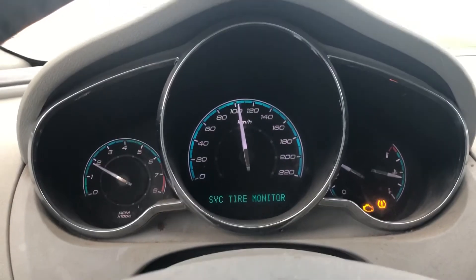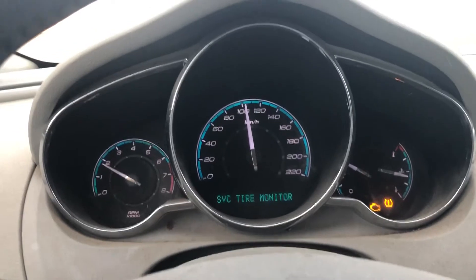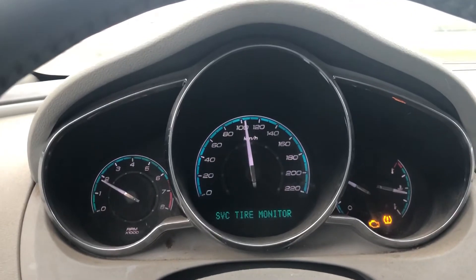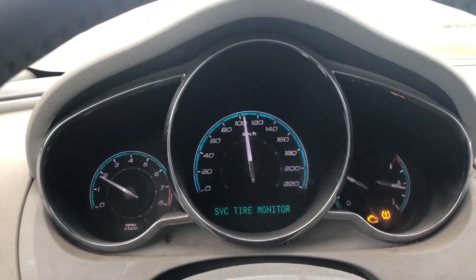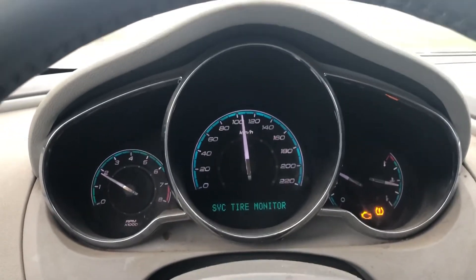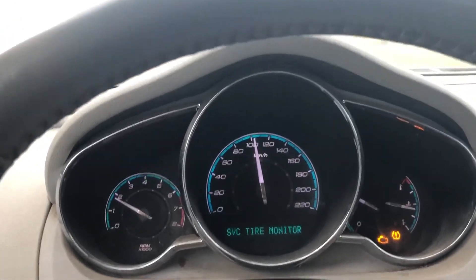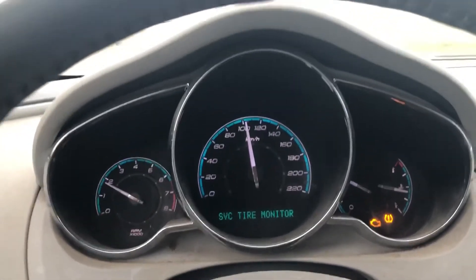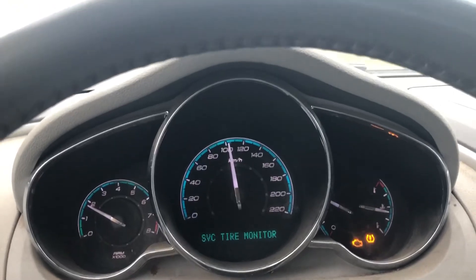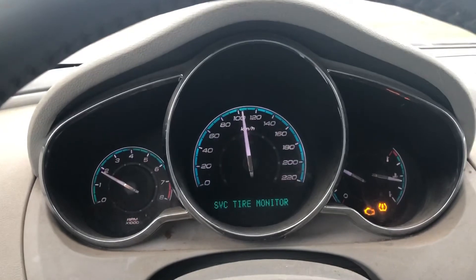As I sit here though, it sounds like it's coming from the driver's side. This is a pretty bad bearing, and I've been burned on diagnosing the wrong side before due to this. Wouldn't be too surprised if both are making a little bit of noise. If you have wheel bearing noise — this howl going down the road — you shouldn't wait until it's this bad before you fix it. But sometimes people leave it. It's not my car; I'm just going to bring it in to work and fix it for them.